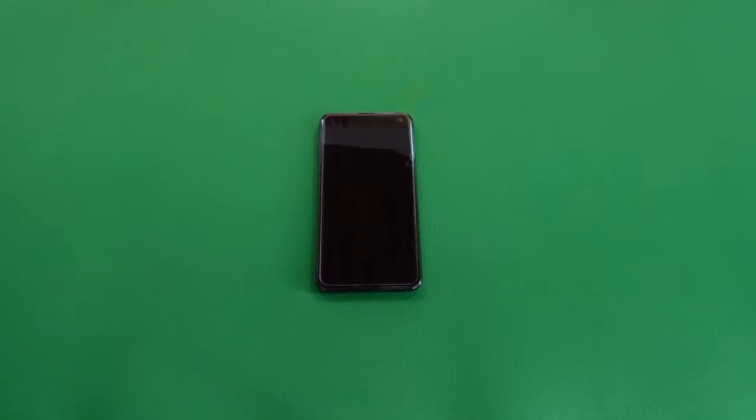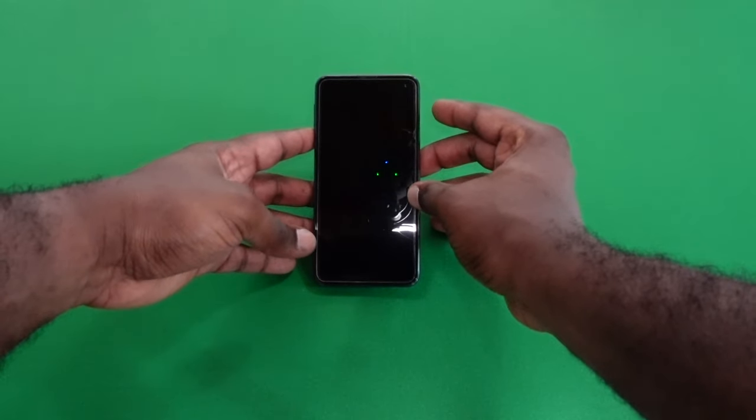I'm going to show you how to replace the battery using the tools provided in a replacement battery kit from Amazon, which includes the replacement battery and all the tools necessary to do it yourself. This tutorial is for people who are nervous about replacing phone parts at home — hopefully it will put you at ease before spending a ton of money at a repair shop. The first thing to do is turn off the phone; you can't replace the battery while it's on.